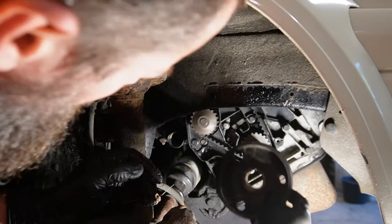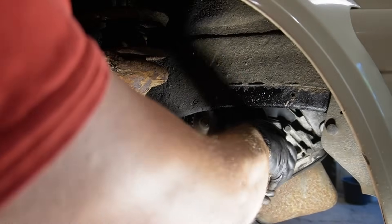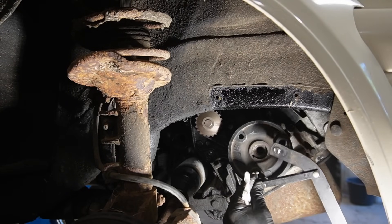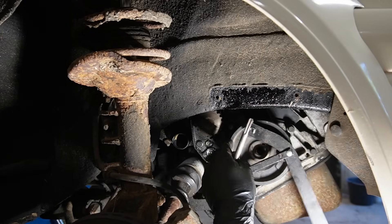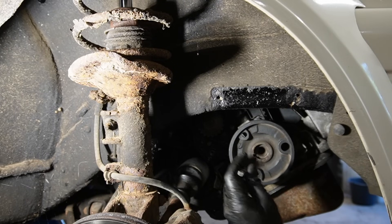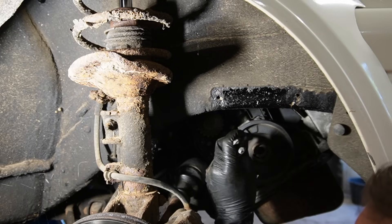I'm just going to refit this because now I want to put the engine on the ignition marks, or the timing marks, and then remove the cam belt. And then I can go ahead and turn the engine until I got it timed. When that lines up, I should be able to just put a 10 millimeter dowel in, which should lock it.